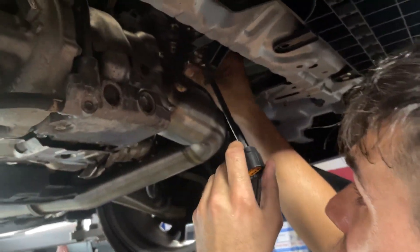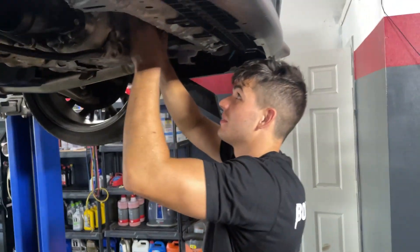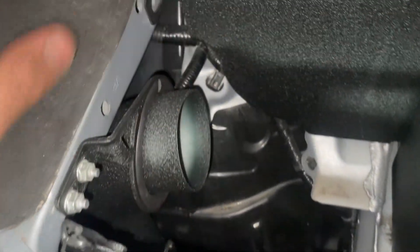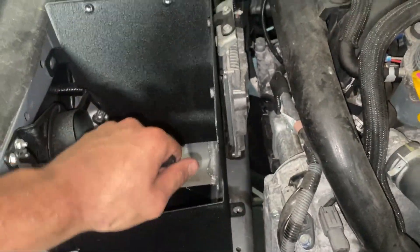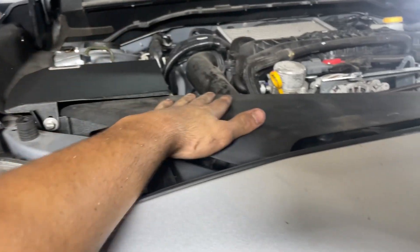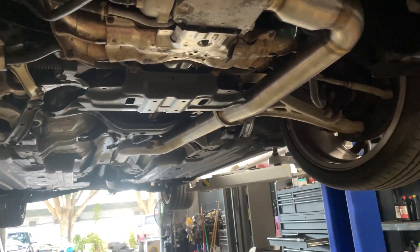Now it's time to replace the O2 sensors, starting with the upstream. I have it unplugged so you don't have to worry about it getting tangled up top and damaging the connection. Now we're fitting the intake. I insulated this area so the intake doesn't rattle around. The intake box is in place with the intake attached to the inlet. Just got to put the cone on, make final adjustments, secure it down, put the top box and duct on, then put the skid plate and under tray back on. We're ready to flash the car.